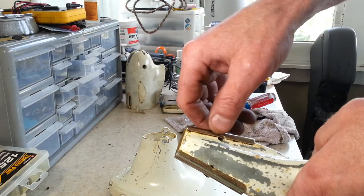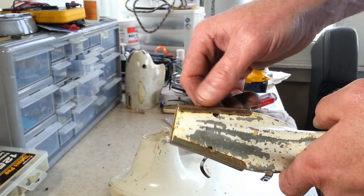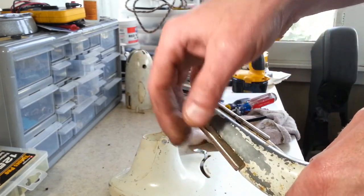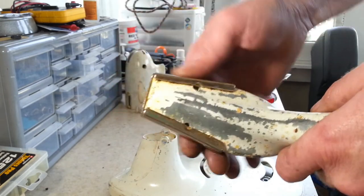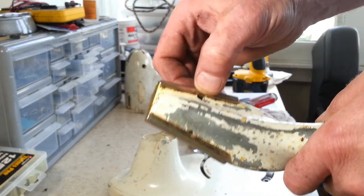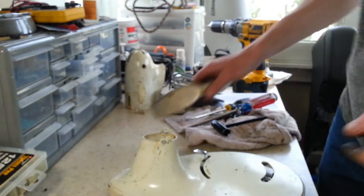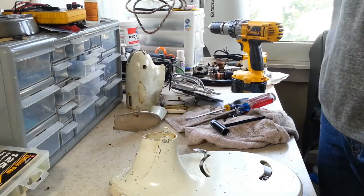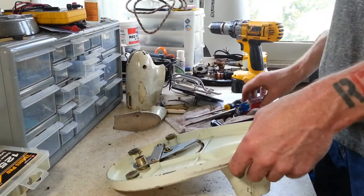It does dig up the aluminum somewhat underneath where this covers, but there's nothing we can really do about that. Once it's back on, you don't notice it. And same thing when we put it back on, we just heat it up and tap it on, and when it cools, it basically locks it back on there as hard as it ever was. So that's something I'm not going to do on camera either,